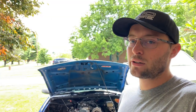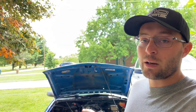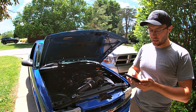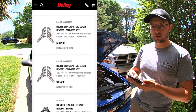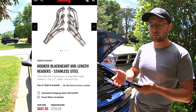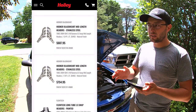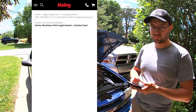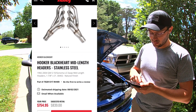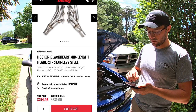The first thing on the list is headers — you've got to have headers. Manifolds don't necessarily work; truck manifolds don't work, and car manifolds don't work from what I've read. The first ones we're looking at are the Hooker Blackheart mid-length headers. The inch-and-three-quarter version is $685 — they were recently developed and weren't available when I did my swap, but I would have definitely bought these. They're better than shorties because the primaries are bigger. Then you have the inch-and-seven-eighths Hooker Blackheart mid-lengths at $754 — I'd honestly get those if I was running nitrous.